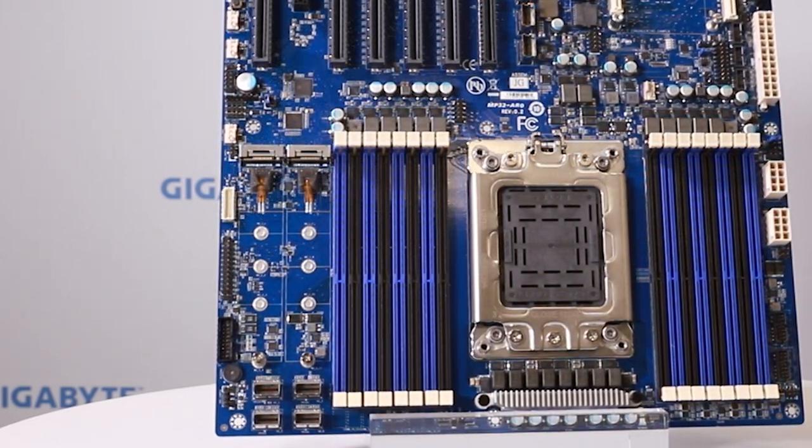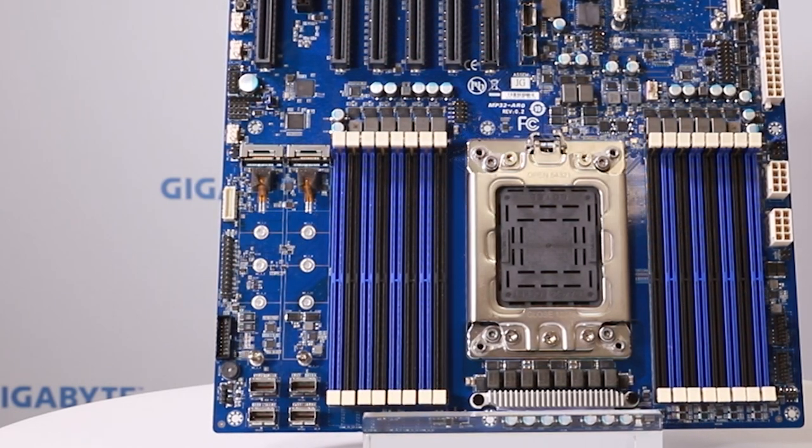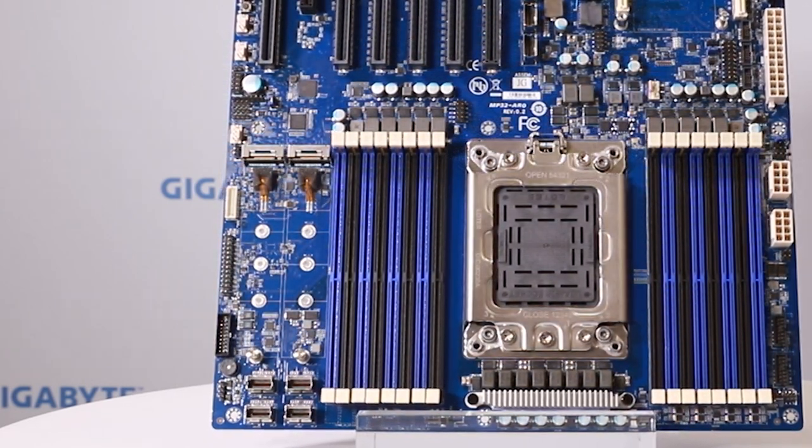You can also install up to two M.2 SSDs in the onboard slots. One more important thing about this motherboard: it's a standard EATX form factor. That means you can use this motherboard in different chassis with the standard form factor — whether 1U, 2U, or OCP type chassis — we can fit this standard motherboard to provide different solutions and different architectures to customers.